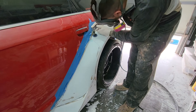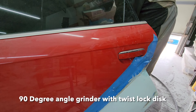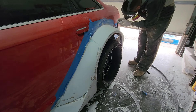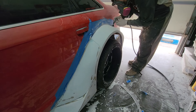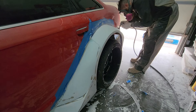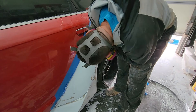You're probably noticing I'm using a 90-degree grinder with a two-inch roll-lock style disc — I believe it's 40 grit. What I'm doing is bumping the edge of that disc up against the actual body of the car and then sanding downward to cut that fiberglass off. That way I know I'm not going to cut through the car itself, while still cutting through the fiberglass.